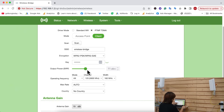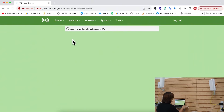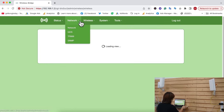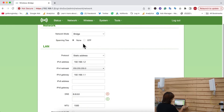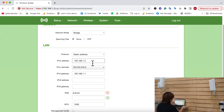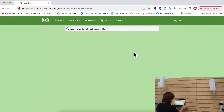For indoor testing, use a transmit power around 10 or 11. When doing it outdoors, make sure you max it. We'll set it to 10 now so we can detect each other at short distance. Everything else stays at default. Hit Save and Apply, then wait for it to connect. Then go to Network — you can use a static IP address and type it in, or use DHCP. When using DHCP, make sure you download dedicated software to discover the IP address. It also supports VLAN management. Now save and apply.